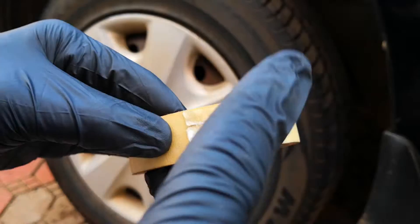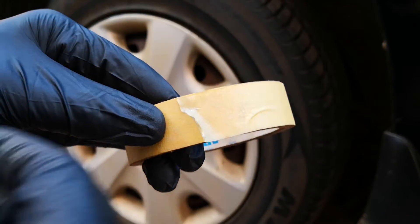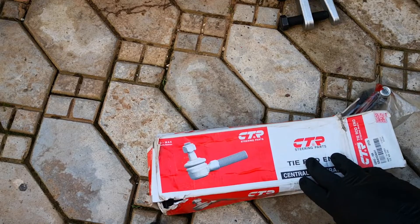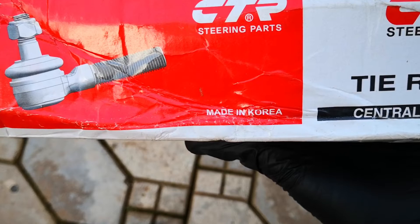Marking is very essential because it will ensure that your alignment is as close as possible to what it was before you started the procedure, so that you're able to drive the car to a tire shop. You should get an alignment anytime you change a major component of the suspension or the steering system. I'm using the CTR brand of outer tie rod ends, which is made in Korea — it's my first time using this brand and I'll be sure to leave reviews on how it continues to perform down the line.